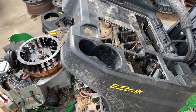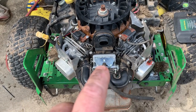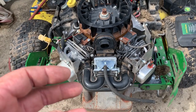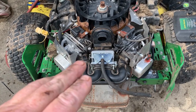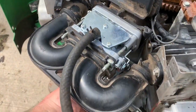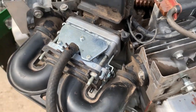If you remember from my previous video, I was talking about this little double barrel carburetor and how when the customer replaced the carburetor they didn't get it put on right — they got some baffles and the swirl plate installed backwards. It wasn't going to idle, so the engine was running wide open all the time.